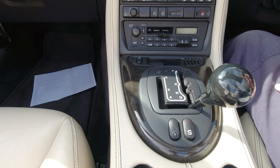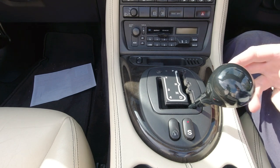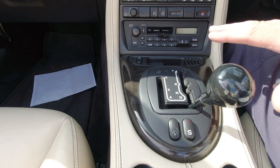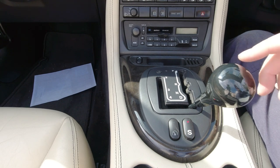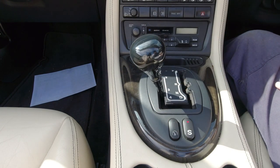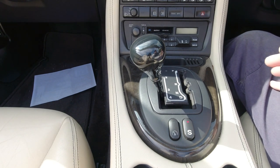What would I be doing in a manual car? I would change down the gearbox and let some engine braking take the strain. So in the XK8, what you do is you see a long steep hill on a country road. Think, well, I'm not in a rush, and get down there a bit slow. I've no idea how tight the corner is at the bottom. You'd probably stick it in third gear and take your foot off the throttle, and the engine will slow you as you're going down that hill.